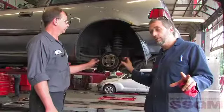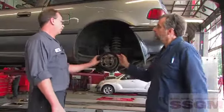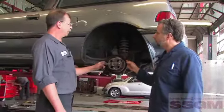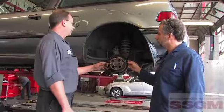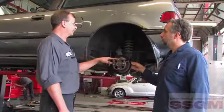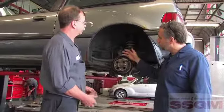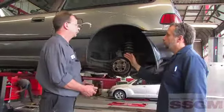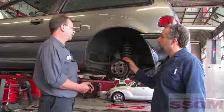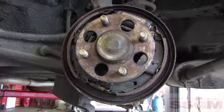Jim now has his brake assembly at the rear complete. This is ACDelco Durastop shoes, also ACDelco Durastop hardware — it's all new hardware. Why new hardware? The new hardware keeps the shoe firmly against the backing plate, returns the shoes on the cylinder, and helps the self-adjuster operate properly. Even if the old hardware looks good, the springs would lose their tension long before the life of the shoe. As for self-adjusters in this high-salt environment in Southern Ontario — they seize probably 20 to 30% of the time. If properly lubricated and the car is driven often enough, they keep working pretty well.